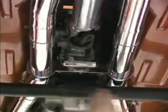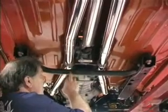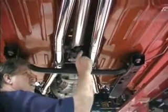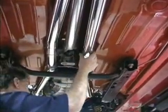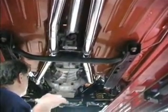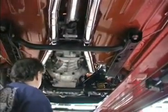See how nice it follows the body — James can really bend that tubing. This is a tailpipe hanger that we made; we might start offering it for the 6-speed. This is the new crossmember we offer for 4L60s and 6-speeds. It's a two-piece bracket — the bottom half bolts up and sandwiches around the pipe. We used band clamps on all the exhaust, so you don't want to do all-welded exhaust because when you go over speed bumps everything's got to give a little bit. With the band clamps, you get a little bit of free movement.